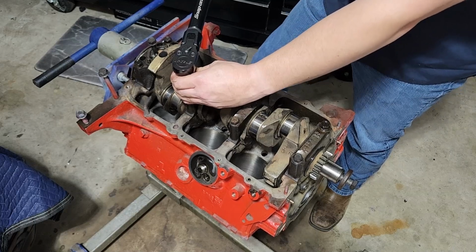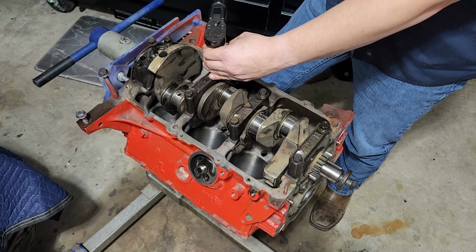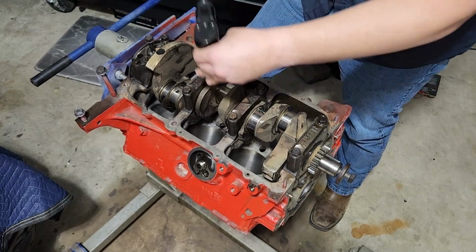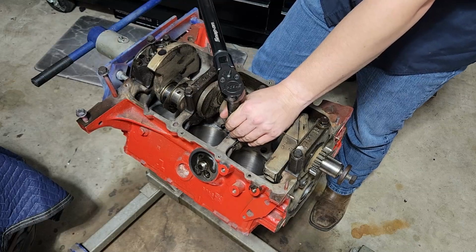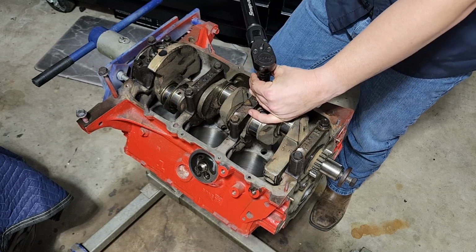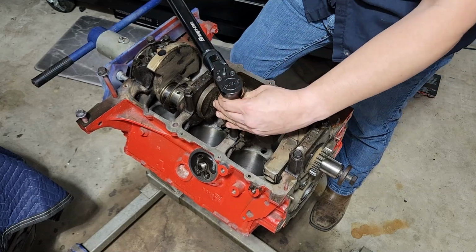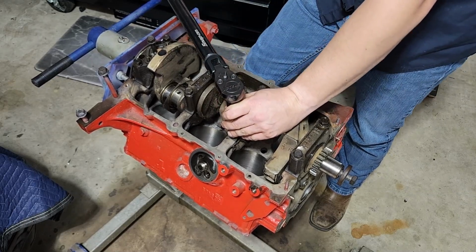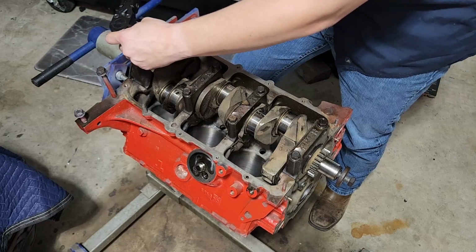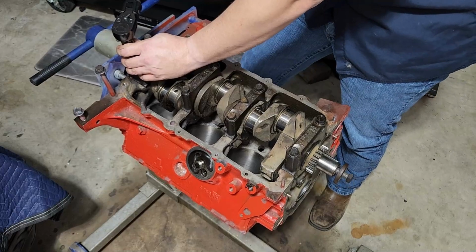So this is equivalent to a clicky one clicking. It'll beep. I'll get the green light, and you can see as it comes on torque. That's one of the slightly neat things about this style torque wrench. I mean, it's neat. I don't think it's a bit more than you probably need. But when you are setting torque with these, always set your torque, then rock it back once or twice. Make sure you're at torque, because you can end up with a kind of poor read just the way you were going down. But I don't think we're going to have any more issues today.